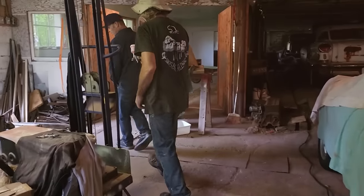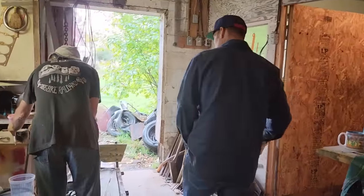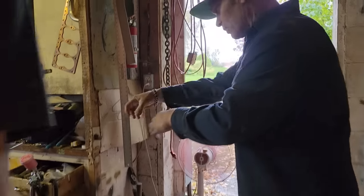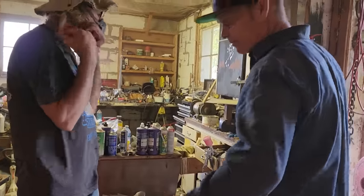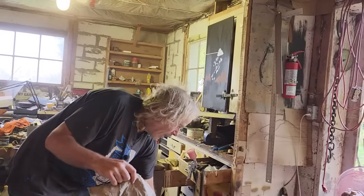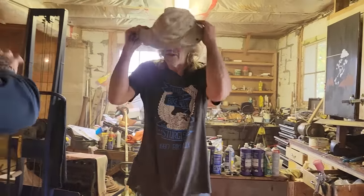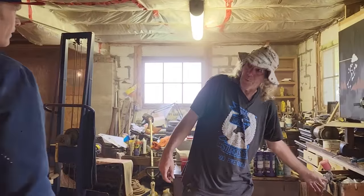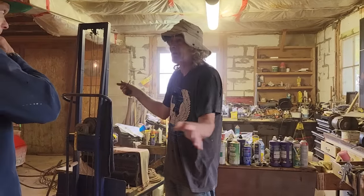So basically what you're going to have to do is build that paint up on that side. I don't know why that fish eye got on you, but that gun probably should have been cleaned, like took the nozzle off and wiped down before you started. It was brand new, right? Yep. And there was oil on the screen. On the intake. There probably was an oil film on the end of the nozzle. You probably should have took the nozzle and cleaned that off. That oil film on the end of that nozzle would blow up through with the air, and that might take a few sprays before it gets there.